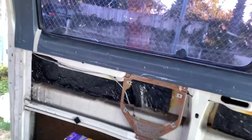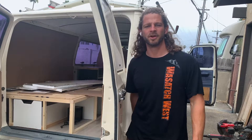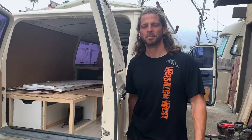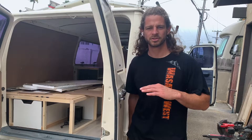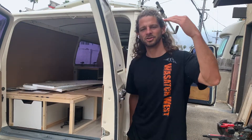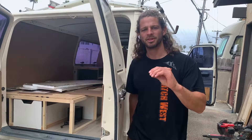I'll block off the windows with carpet-covered panels that replace the roof all the way down. The flooring I've put in the van is a little different from any other van I've seen on YouTube. I wanted to share my creative solution for insulation on the floor. All I see is a lot of thick rigid foam put down beneath the plywood subfloor, and that just makes you lose an inch of headroom. It'll provide some soundproofing, but it doesn't insulate as well as people think, so you might as well get something thin that's waterproof.